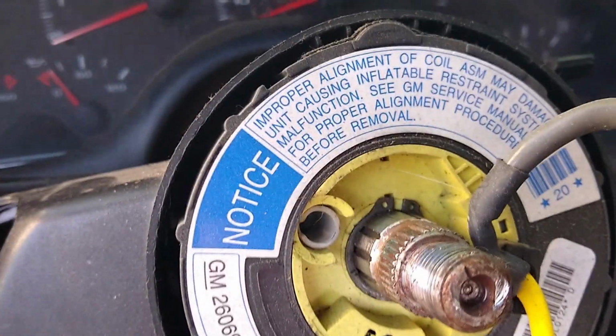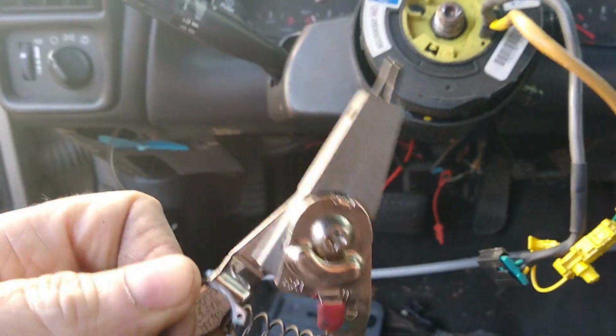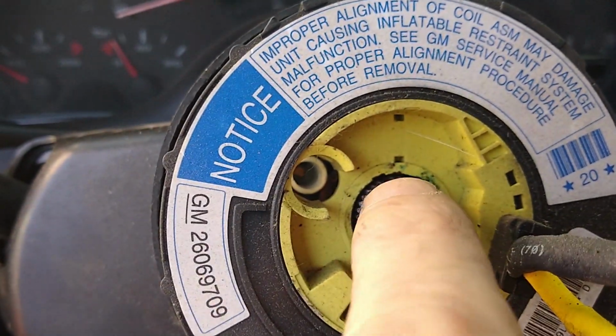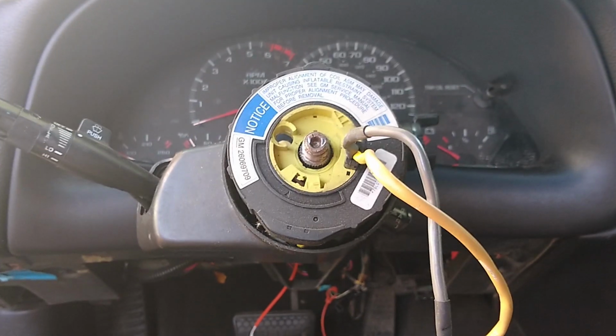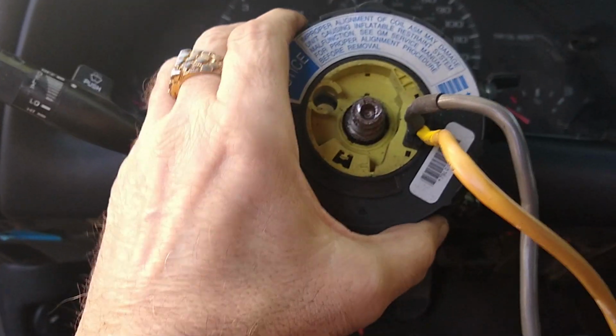Next I see a C-clip right down in there. Tackle that one next. Well, that wasn't too tough. Had to use my channel locks here. So I got that off, and then this I had to wiggle and pry on a bit, and now it's sliding off. I also noticed the register right there. There's like a key missing, and I want to make sure we get that back on the same way, just like that. And the steering wheel also will line up with those registers when it goes back on.